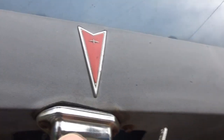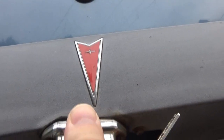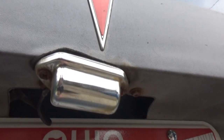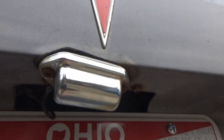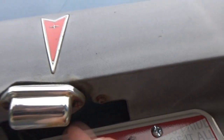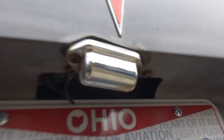And so I took this off. This screw here that they had was awful, so it's not really sitting the way that it originally was. And I pulled it out and I came to notice that one of the wires has actually been sheared off by corrosion. It was green on the end. It was ripped right out. It's sitting up here somewhere. Like I said, I just stuck all that back up in there for the time being.